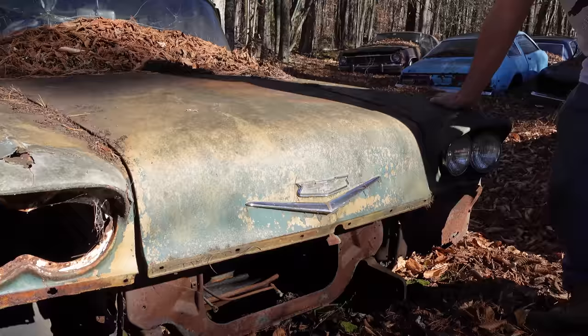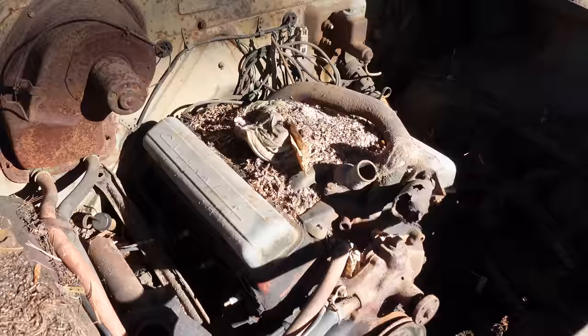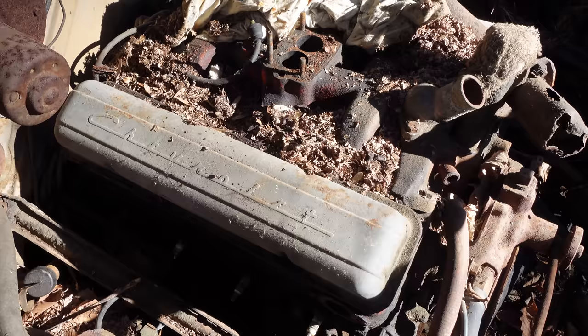Do we have it here? Let's get the drum roll. Okay, well, this is the small block — in fact, it's going to be the 283. Is it a two-barrel? Yeah, two-barrel carburetor right there. There's also a four-barrel possibility, and believe it or not, the 283 could also be had with Rochester's mechanical fuel injection right through '59. But not here — this is the basic workhorse two-barrel 283.